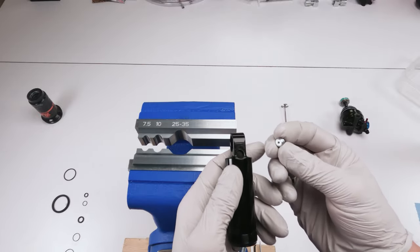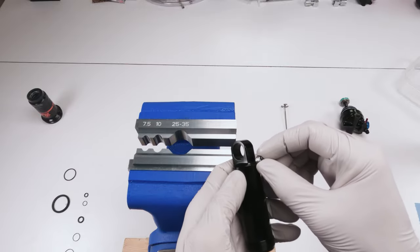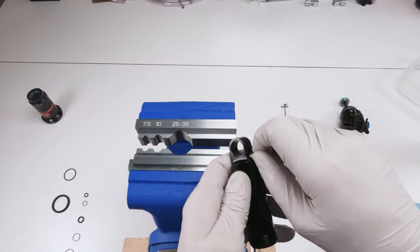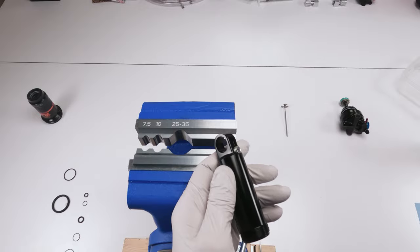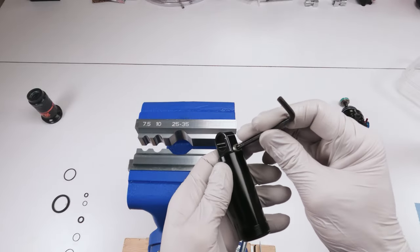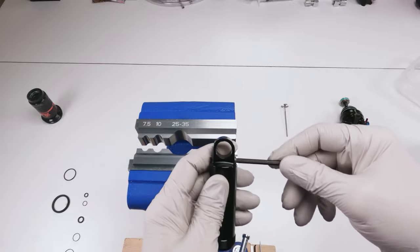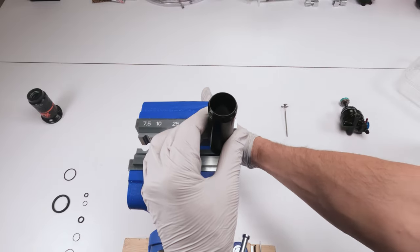Then we take our air screw or pellet retaining screw, right? Hollow side, or the screw side, stays up. And we grab our 5/32 and we screw him down. Don't jam him down there, just tight enough, okay? Then we're going to take this guy and put him in our vise.